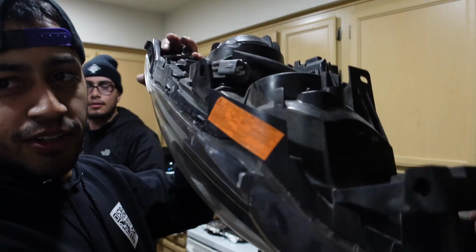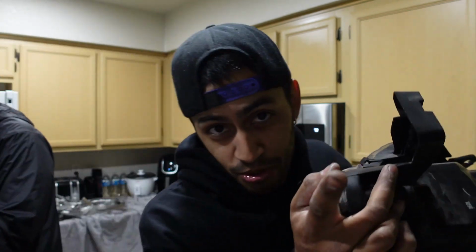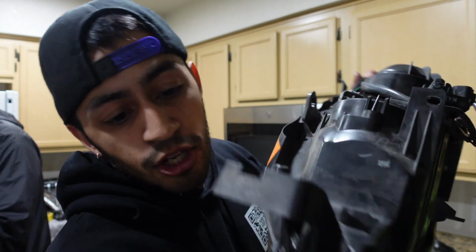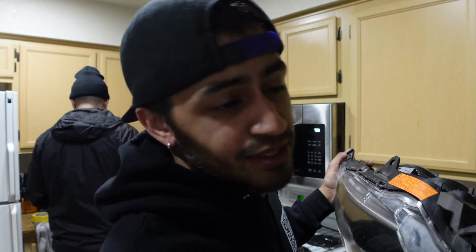After you put everything back together, simple. Put your headlight on, your other half of your headlight, and all you do is throw it back in the oven. Fam, stop throwing tongue at me. You don't throw tongue. You throw your headlight back in the oven for another 6 minutes and squish it together. Put your screws on, close your tabs, and you're done. Simple as that.